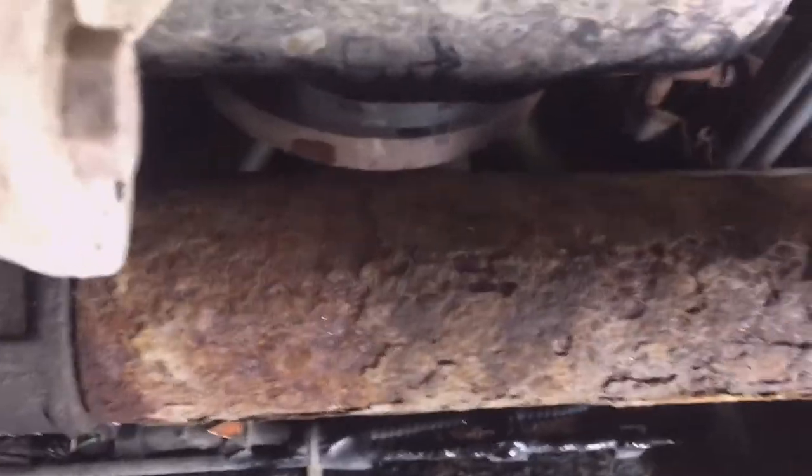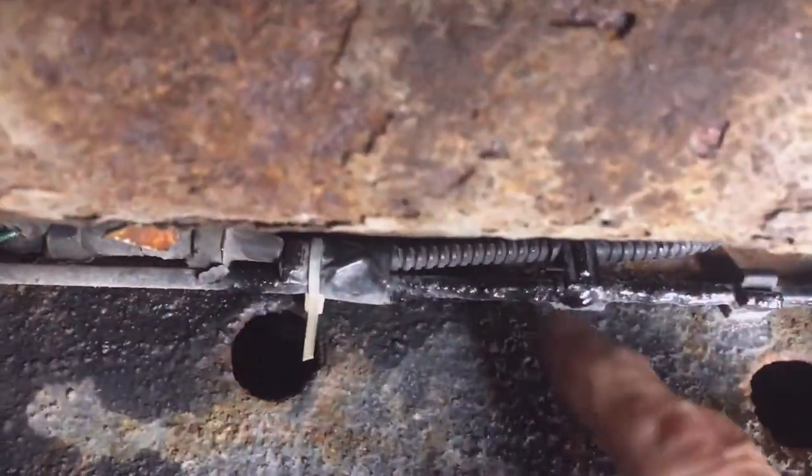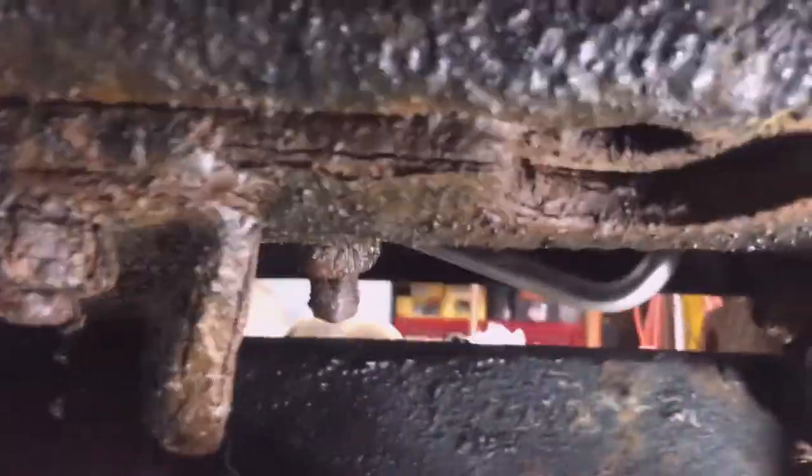You have to work underneath the engine oil pan and the engine cross member here, and then across the steering gear rack and pinion, underneath the oil pan, and then over the cross member here and the lines. The only word of caution is, as you're bringing that front part of the hose through, the back part comes up here into the starter area, and once you're in the starter area, you gotta be careful, the lines will get all the way up and get up into the positive cable.